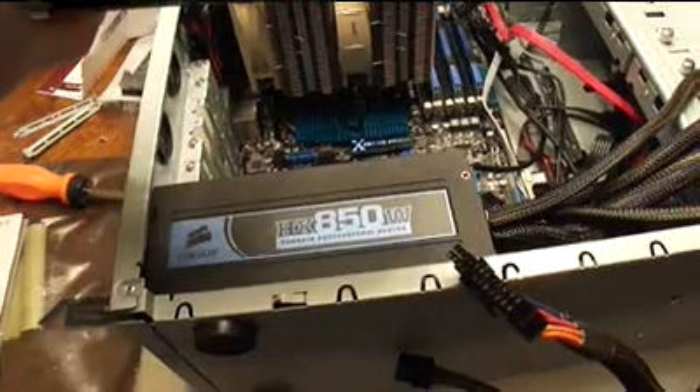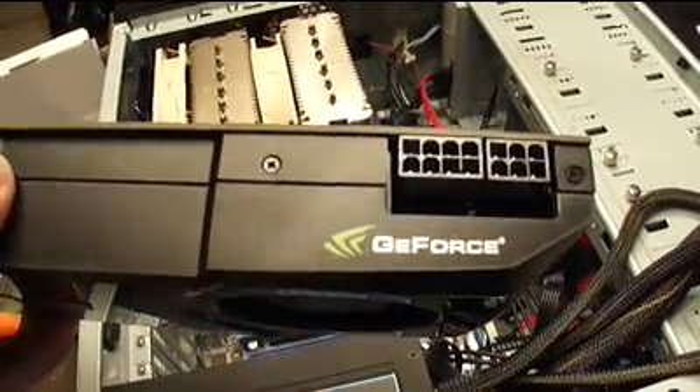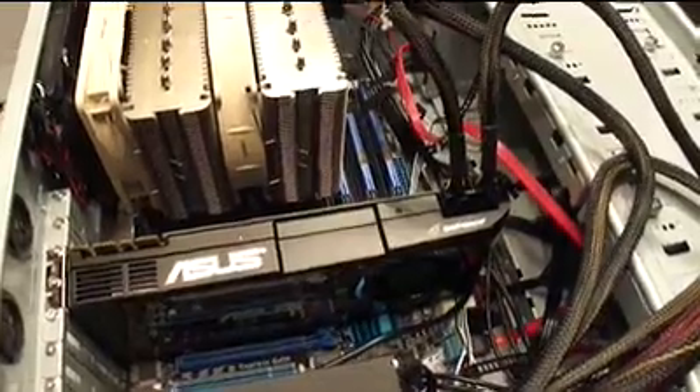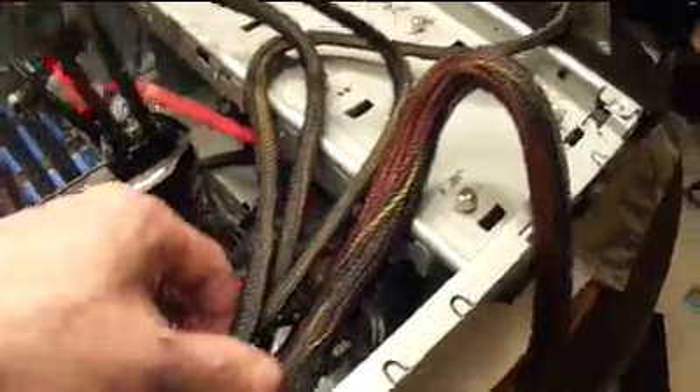It does come with protective coverings on the bottom and on the two sides, so I'll be popping them off before dropping it in. Dropping it in, it falls right into that slot, and then I'll put screws on top. The power comes right from the modular power supply with the built-in PCIe connectors. These connectors support either eight or six pin — I'll use eight for one and six for the other, just in case the card wants to pull that kind of power during rendering or physics simulations. The graphics card is now in place, locked down with screws from the outside. I have the eight and six pin connectors in there coming right off the power supply, so I didn't need to use any modular ones — since they were already built in, I might as well use them.